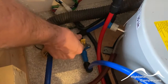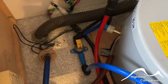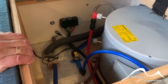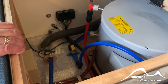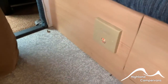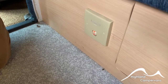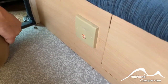To recommission it, put it back in horizontal position — it doesn't matter which direction, just as long as it's horizontal to the floor. You'll then turn on your hot water taps and draw the water back through the system — when you get a consistent flow of cold water coming out of your hot taps you're ready to start heating up the water heater. If you're going to heat the water up on mains electric you'll be connected to the mains supply, turn on this rocker switch and around about 40 minutes it'll heat the water up to around 60 degrees — high enough to kill off any bacteria within the system.